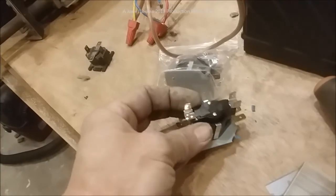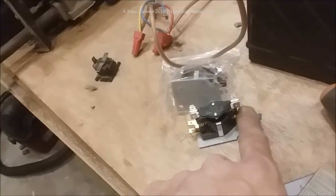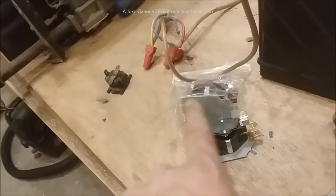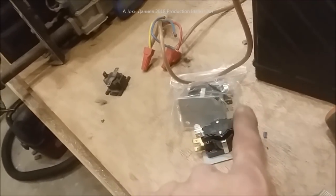All you've got to do is get one of these. You have your thermostat wire, your ground — and it doesn't matter which one because it's just a pass-through on a switch — then you have your fan and your power, your supply coming in, your red wire.